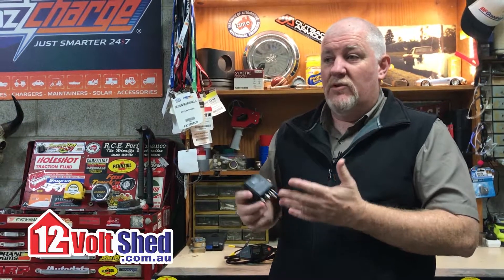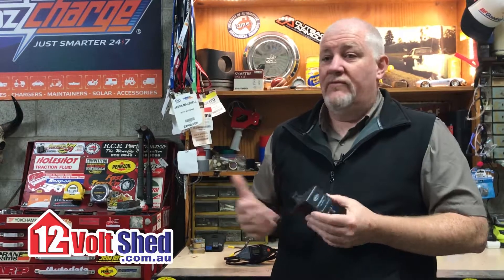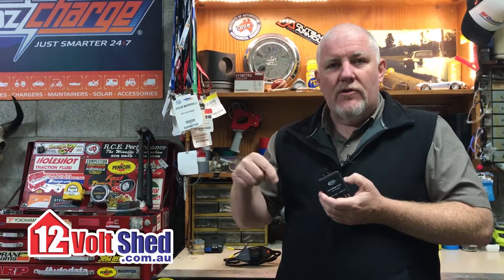If you've got a 100 amp battery and you only want to take 50 or 60 amps out of it, you've got five or six hours worth of load at that rate — rough figures — before you need to disconnect it. Those fridges run a little heater element; it's a static load on the battery, so it'll just run that battery to absolute zero, which is really not good. That heavily sulfates a lead acid type battery, and that's really not great.